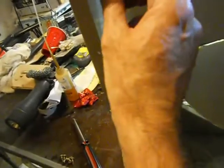What we want to do is deal with the power cord for the purposes of installing this thermostat. So here's the power cord as it comes up to the switch. We're going to make a little splice. Now we have to figure out where we're going to mount this thing so that it makes sense and is out of the way of the blades.